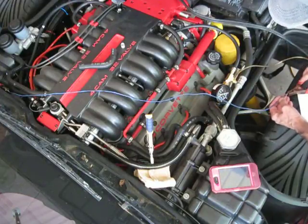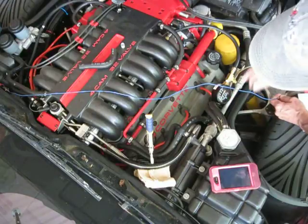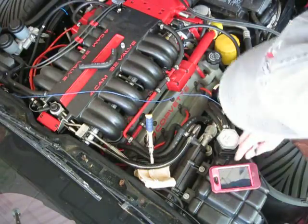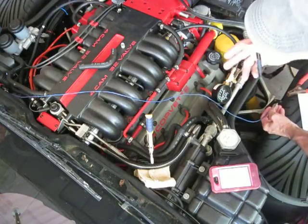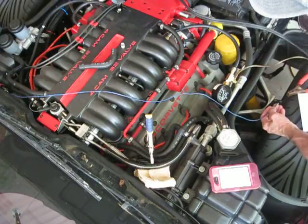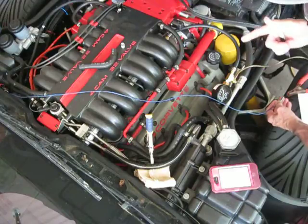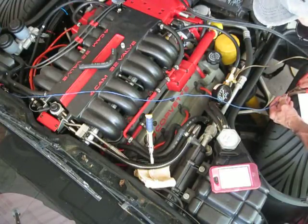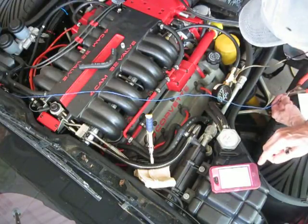Let's go ahead and make the connection, and you can see on the gauge it goes up. Don't hold it too long. Remember, the normal time is, well, let's try this again. Okay, let's try it again. Remember, your normal prime period is 2 seconds before the pump shuts off. The ECM shuts the pump off and waits for the motor, or the ECM, to say the motor's spooled up to resume pump operation.